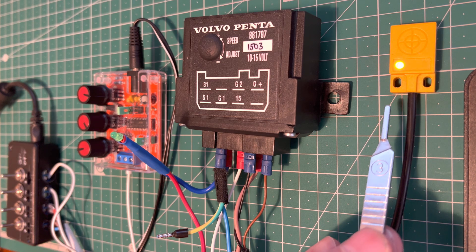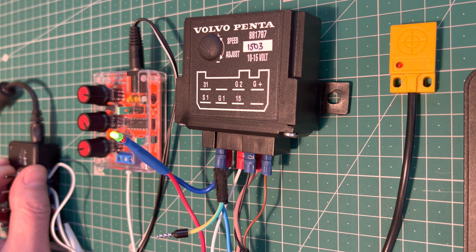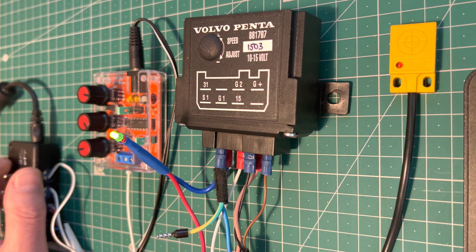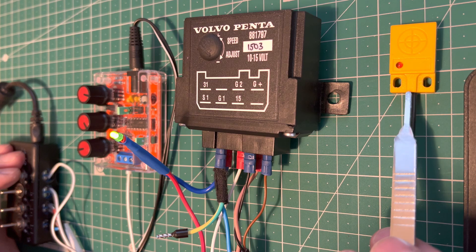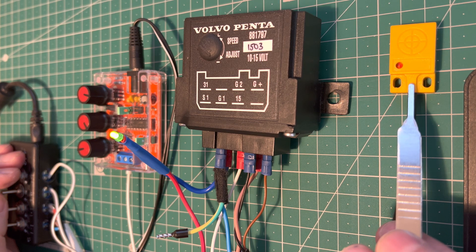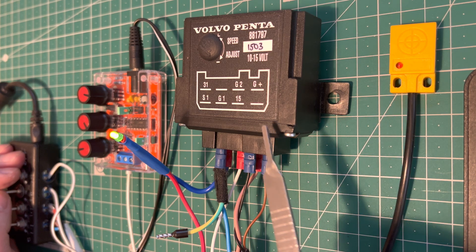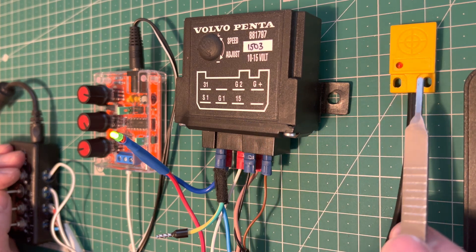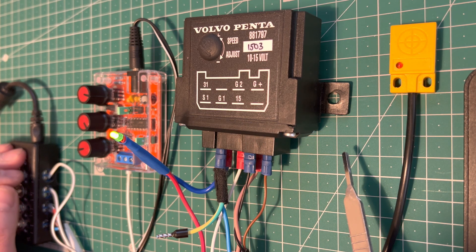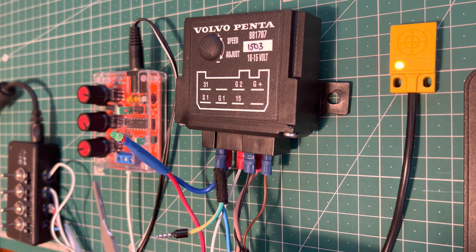The proximity sensor is lit up and the whole system is already powered up ready to run. Something of note: if I disconnect the proximity sensor, you'll see it goes out and the supercharger light here lights up. So if your proximity sensor has a bad connection or it's faulty, that can make the supercharger run. The proximity sensor can make it look like the controller is faulty, so it's just something to bear in mind. Reconnecting it now — it's gone out, so the supercharger's not active.